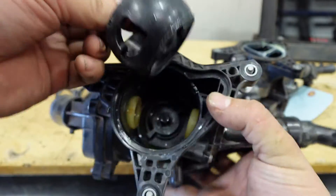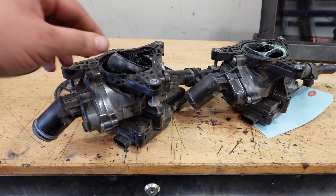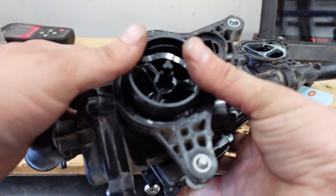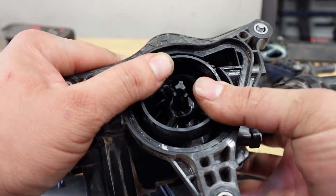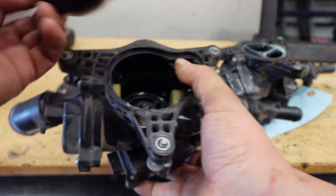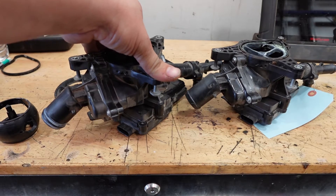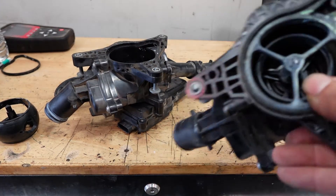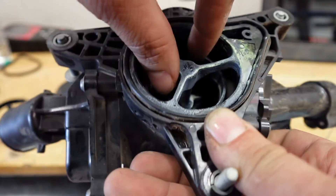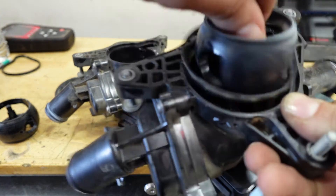What's happening is this coolant control valve is getting stuck in a fail safe mode called 'dry hollow.' I had to Google it because I didn't know what dry hollow meant — it pretty much means the absence of moisture. It goes into this fail-safe mode and there's no opening it and fixing it; the only thing to do is replace it. This other one is also stuck — here's the passage, and they're just open when they shouldn't be whenever you start the engine.